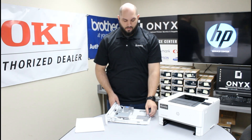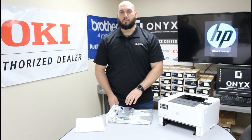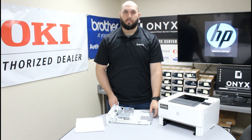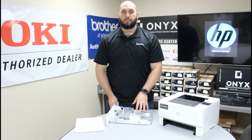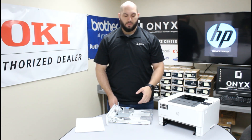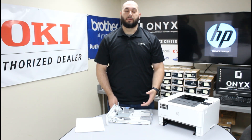It works the other way as well. If you put as much paper as you could in there and the adjuster gets knocked back over time, it can allow too much room inside the paper tray. The paper can shift back and forth and the printer has a hard time picking it up. It can also tell the printer that there's a bigger size piece of paper inside, so it's looking for a longer sheet and thinks there's a paper jam when it's pulling paper through.